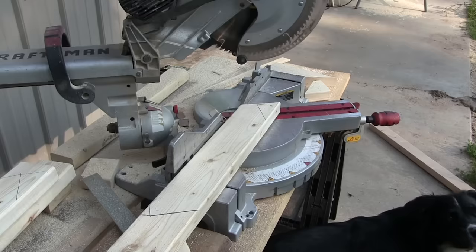To fill the gaps between the front angled boards to make up the front corner, I had to cut that board at an angle and screw it in place. That way the front will have something to nail to all the way across as well as the roof. This doesn't have a whole lot holding it down, so I'm going to box in the wheel wells with 2x8s, then sheet it with some paneling. I'll screw this 2x8 in and run some screws down along the edge, then make a box so that will support this better yet.